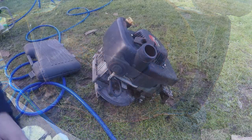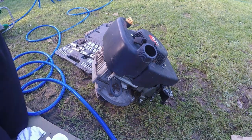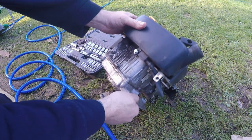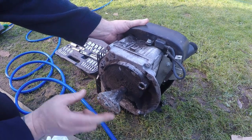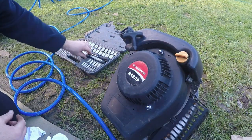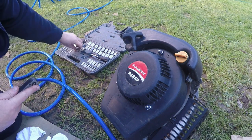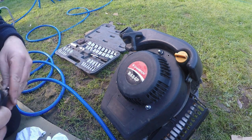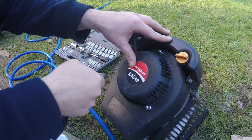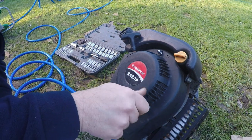I'm going to grab an old engine and try to take the flywheel off. Here's an old engine I've got — it's a non-runner, there's no compression on this engine so it's no good. There's a blade boss that needs to come off of here which I'll show in another video as I've got a new puller as well. I'd say it's going to be a 10mm with an extension. This is good for spares — tanks, pull cord assembly, all that sort of good stuff — that all costs money.